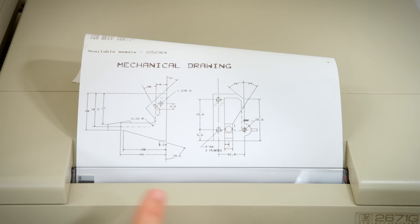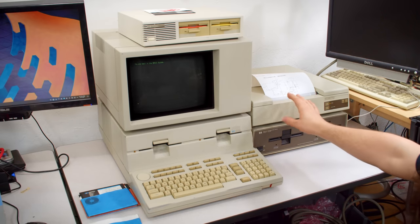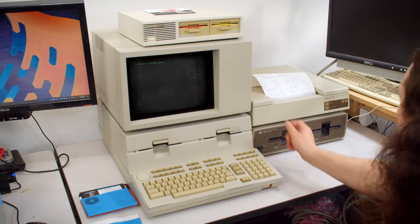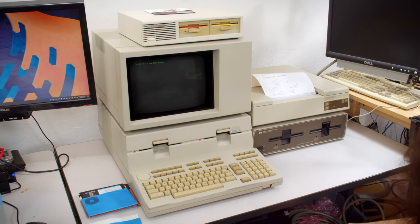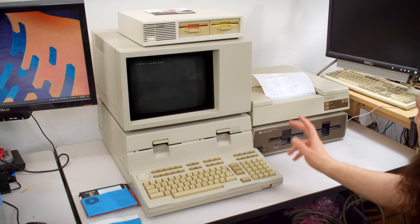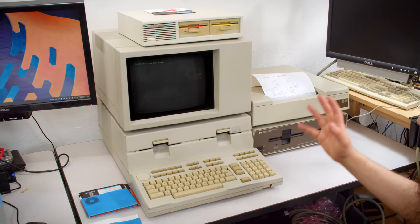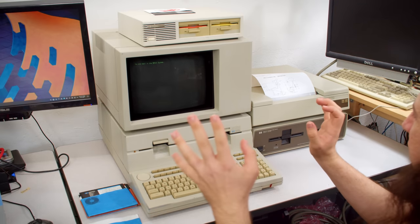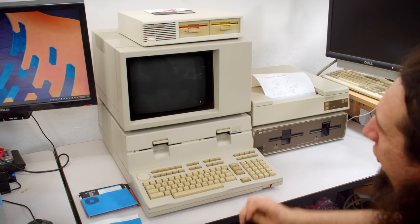So the way the software is expecting it to work is for bold, let's say, you'll print one character, which would then move the head forward. Then it wants to half step back so that it would have two slightly overlapped characters, print again, and then move forward. This may do the micro stepping, probably, because it does graphics, but it doesn't do the back positioning, which is a little weird, I feel, but oh well. It's a shame that the word processing software can't just rasterize the text to do this, but it probably shares a text backend with dot matrix printers as well. But enough of what it can't do, let's see what it can do. And we'll hit run to start the software.